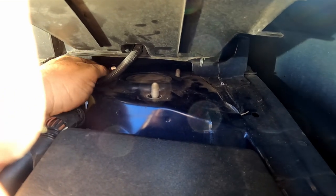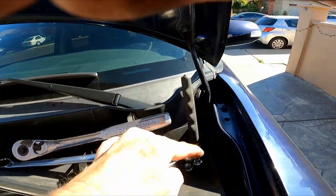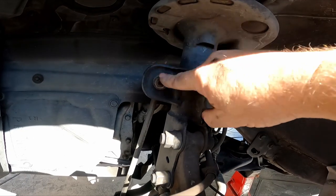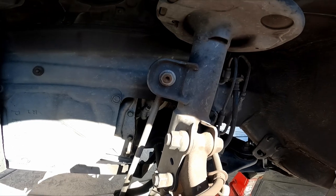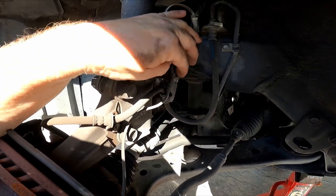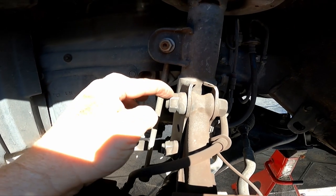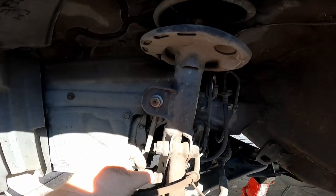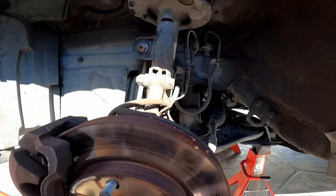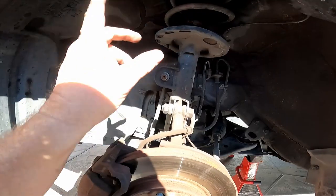Just like that — take it off and put it with the rest of them down in this little pocket. Thank you, Toyota. Now take a look under here — this is the sway bar bracket bolt right there, 17 millimeter. We've got the brake line and speed sensor bolt, which is 10 millimeter. And the main strut bolts are 22 millimeter on both sides. Let's go ahead and get those off and get this thing pulled out — it should be pretty simple. There is one little clip right here that I'll pop off with a screwdriver, then we'll be able to take the strut off and start taking the spring off.